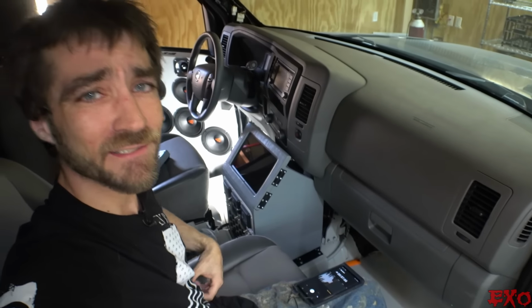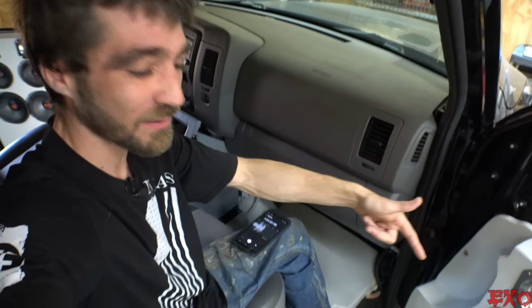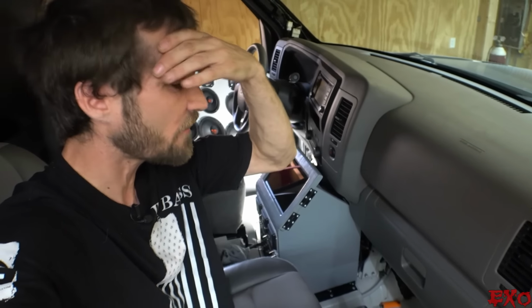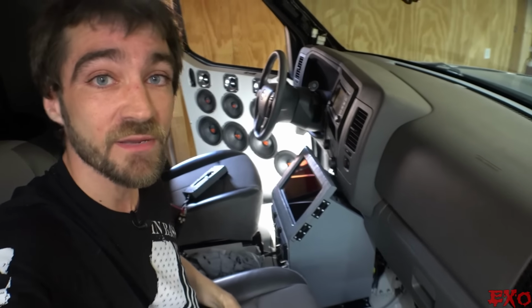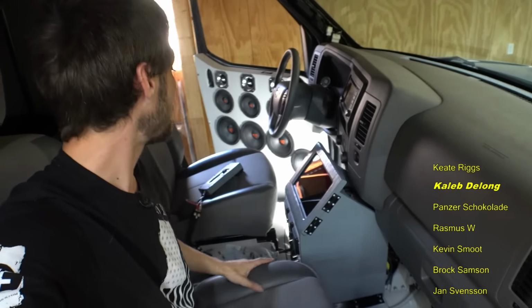At least we were able to fix a couple few of them in this video, hanging out with you guys, did the side view mirror, plugged up our door panel. We're still gonna have to figure that out here in the next video. I got some 4-channel amps, but I shot myself in the foot because I can't bridge them at 2 ohms, so I'm either gonna have to reconfigure at 4 because I got 8 ohm right now. So I don't know. We're still going to figure that out. It's always something when you got a big build like this.